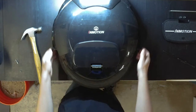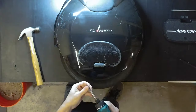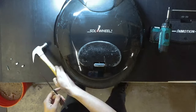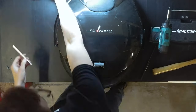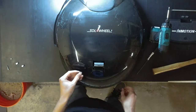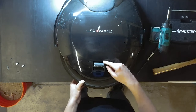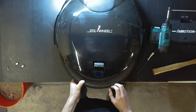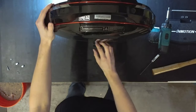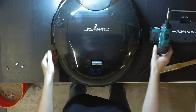The process is exactly the same on the other side, so I'll go ahead and replace the other pedal. Something that just happened — I've never actually had this happen before — the spacer has gone up inside and is now resting on the pedal hanger. But don't worry: to solve this we just flip the wheel up and the spacer slides right down. We can put that off to the side and then continue on.